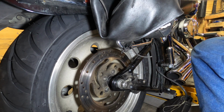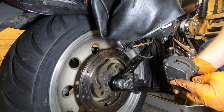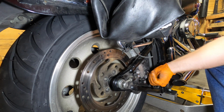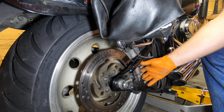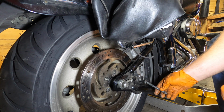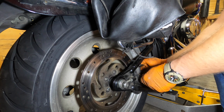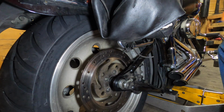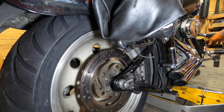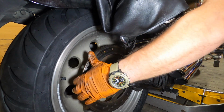Now we're going to take our brake caliper out of the bag. Brake pads looking good. Gingerly fish this in, getting our pads over the rotor correctly. Remember, our longer bolt went on the bottom here. Should be pretty easy. Pump them up. See if it works. Yep.